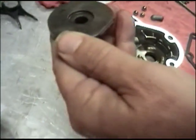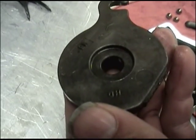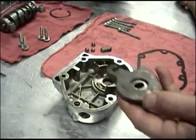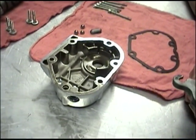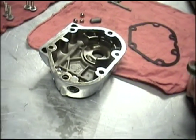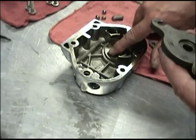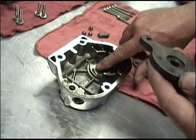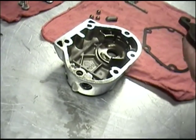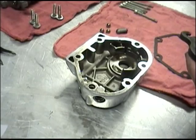Remember me telling you that these things were marked with a number? Yeah. Okay. 18. This is an 18. All right. What's the other ones they're using, Rudy? 22, 25? 20. 20? I see the 20. Okay. Anyway, as they change the ramp of this, if they make it more progressive and not as steep, it also changes the leverage. It makes the lever easier to pull.